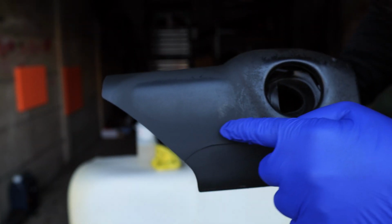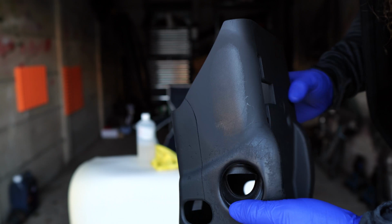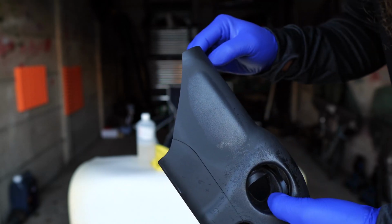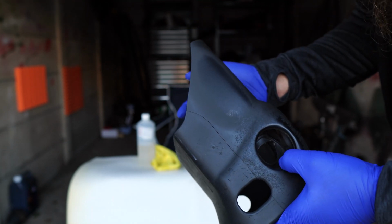So this section here has been completely done. You can see the rubberized coating, trying to get the best angle. You can see it's completely gone, and you're just left with this nice, smooth matte plastic. You can either dress it with a shiny dressing if you want, or you can leave it like that. Or you can buy that rubberized coating paint which we got from Halfords for the front grills. Again, I'll put a link in the description for that.